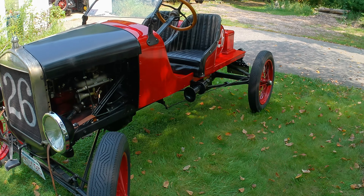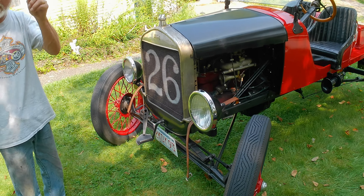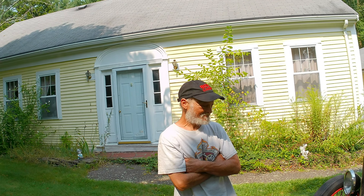My next problem might be the universal, but if I get the rear end it's all going to change anyway. The muffler on the 1926 — the hanging pot — doesn't come out round, it puts down a slot. I want to put a tailpipe on it to keep the soot off my rear end. I'm thinking about taking two front pieces and putting one in the back. Mine is a tractor supply muffler off a tractor. I think I'm going to put Model A exhaust in it and see if it changes the sound — guaranteed it will.